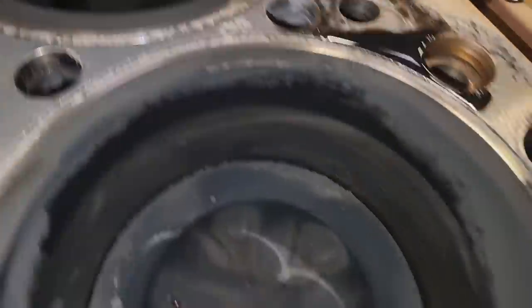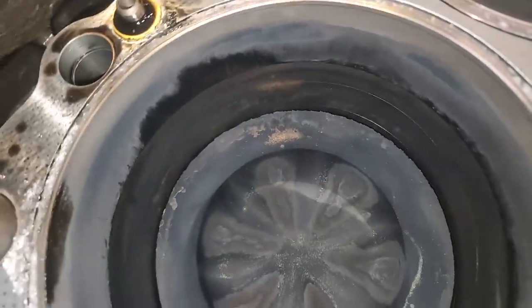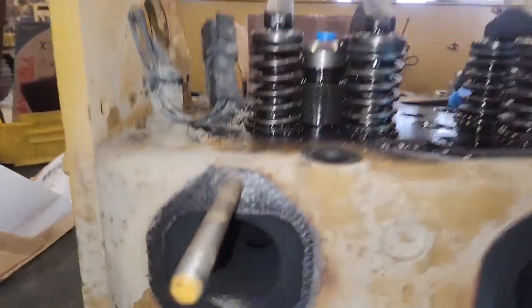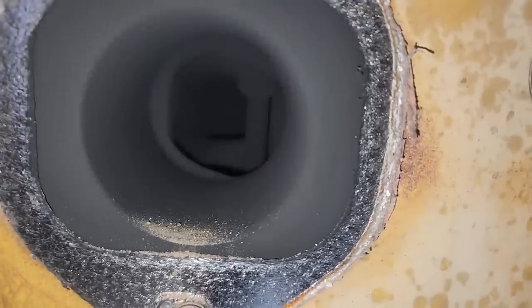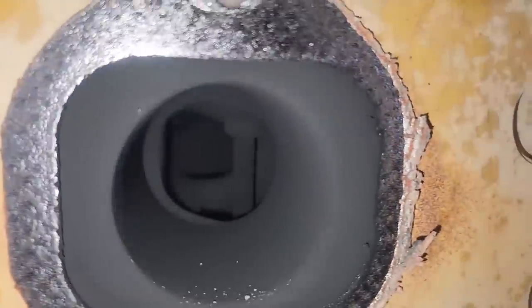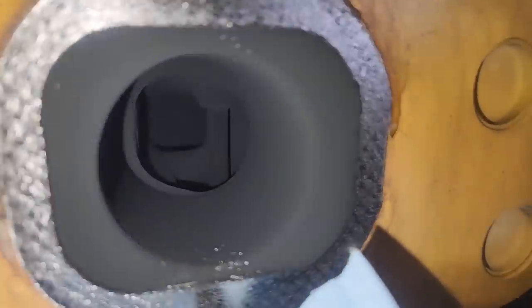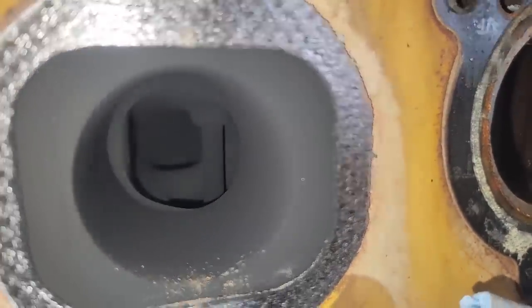The carbon rings are quite big, but these use aluminum pistons. According to SIS, the ring is kind of in the center of the piston, which would explain why the carbon rings on top of the liner are larger than what I'm used to seeing. I was then told to pull the exhaust manifold off. What we're looking for is any sign of excessive oil in one of the exhaust or intake ports. The exhaust ports looked pretty clean and uniformly sooted with no sign of oil.